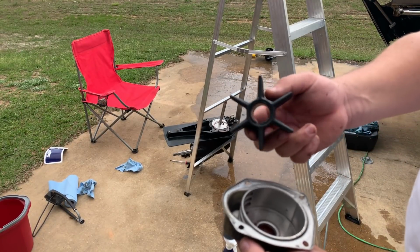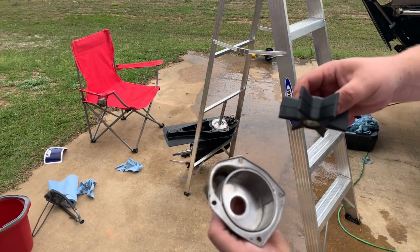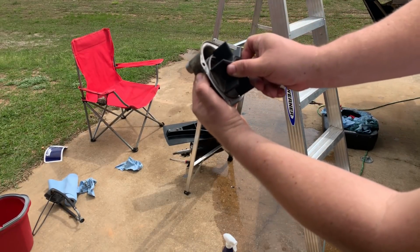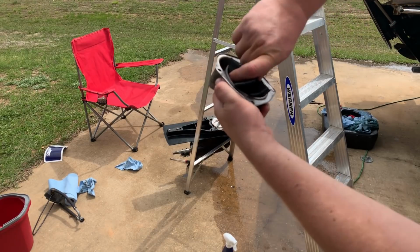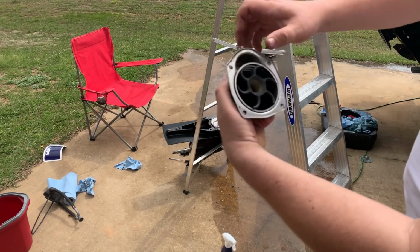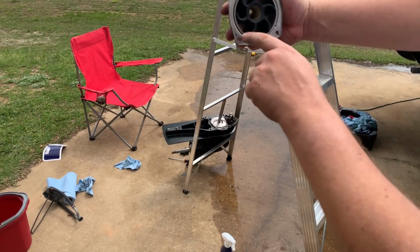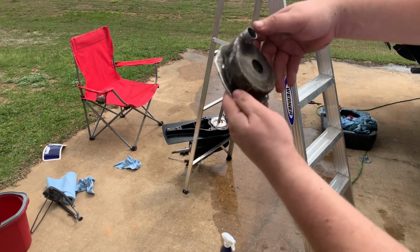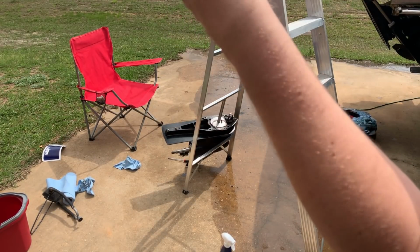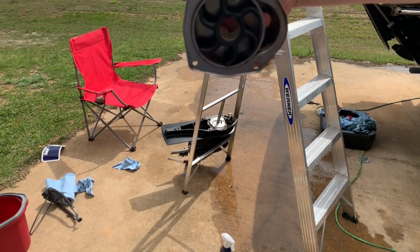When inserting the impeller, it's important to keep in mind the rotation of the main shaft that it's going to sit on. Looking at the housing facing you from the backside, when inserting, you want to give it a counterclockwise spin like this. So you see the blades, if looking this way, as if it's rotating counterclockwise. The reason being is that once it's sitting on the pump, the shaft actually rotates clockwise, so therefore we have correct spin. It's very important not to mess this part up.